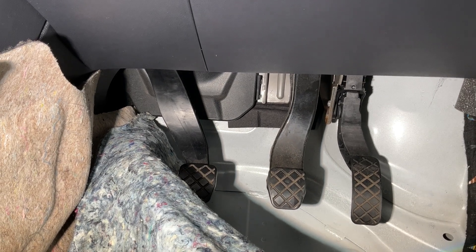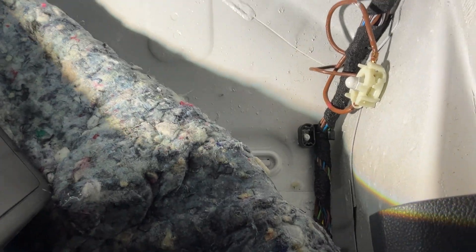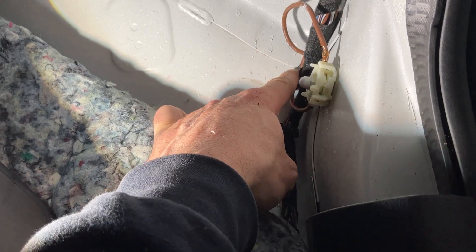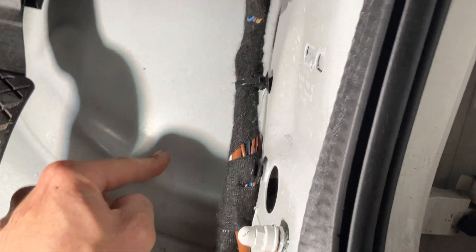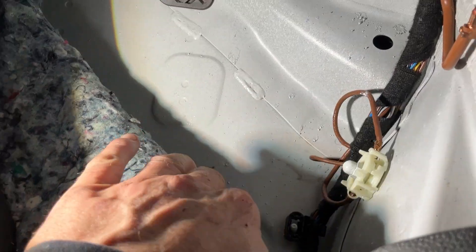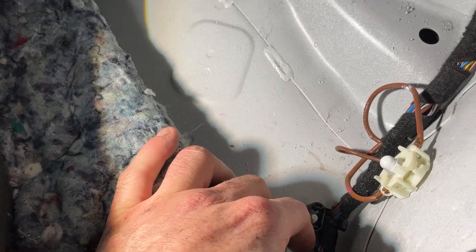It's a little bit of a secret one. The reason being is that welded seam here is letting out water. What that must be doing is going down inside the skin between the bulkhead and where the scuttle area is, then running down the inside of the bulkhead, exiting out of here, and that is causing us to have more water around here. We believe that would be the problem on that one.